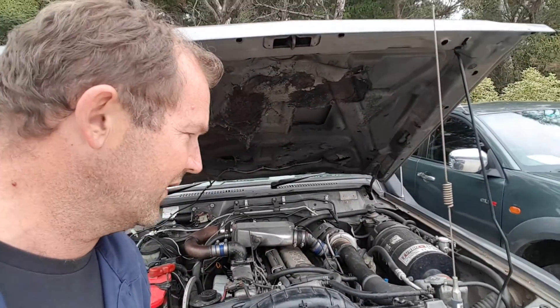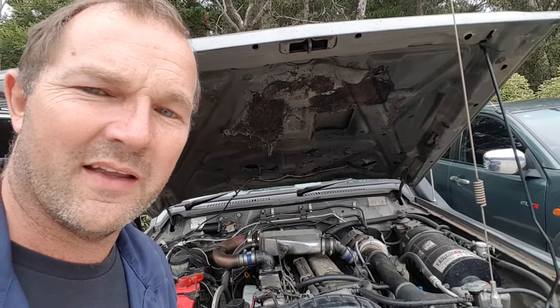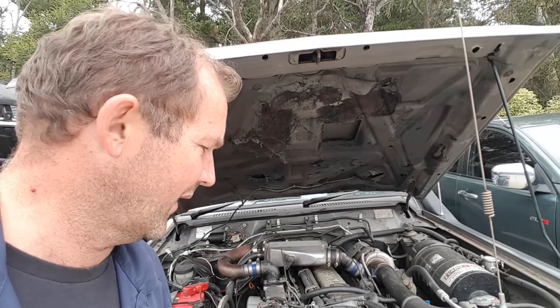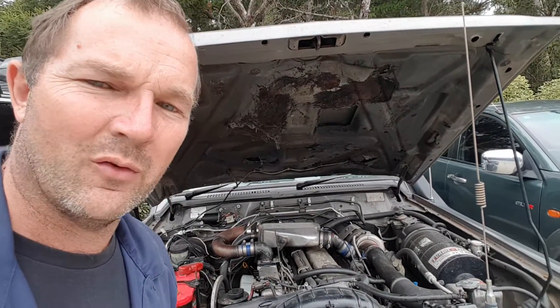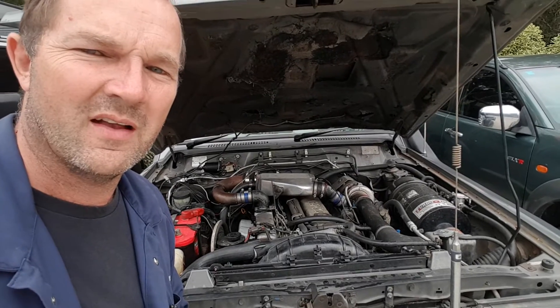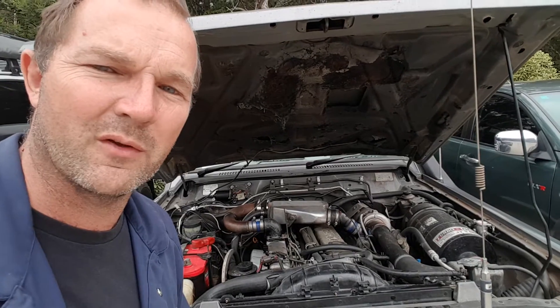I'm sure that's the overheating problem. We've taken it for a run and it overheated very very quickly, and yet the engine didn't feel super hot, but the cooling system did. So more than likely the poor old radiator's just not getting any air. Remember — particularly with aftermarket turbos and stuff — just make sure you're very aware when putting on additional accessories that are going to block your airflow up to the front.